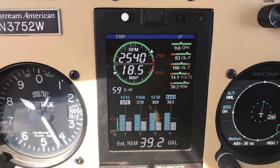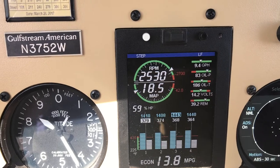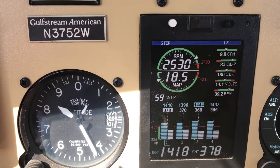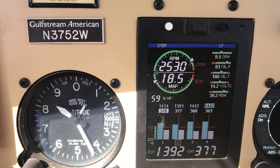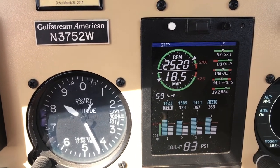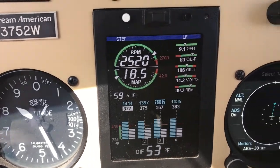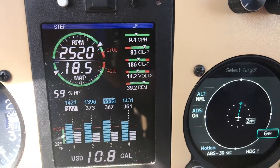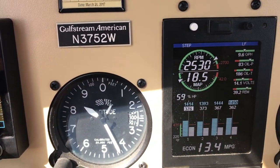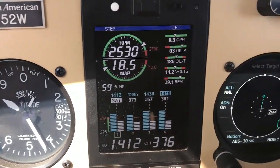So there we go, everything checked by the charts. It settled back to below 2600, but at 8500 feet, wide open throttle, I get about 2640 RPM — actually it got to 2700, that's right, got over like 2740 RPM and 72%.